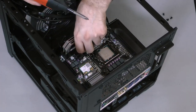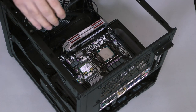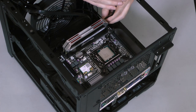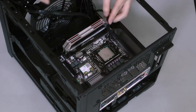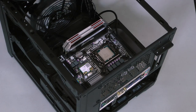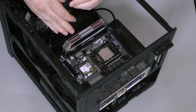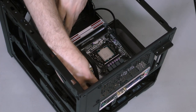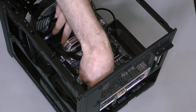After that, I'll need to connect the case headers — check your motherboard's manual to see where each one is. First, connect the audio header that hooks up to the microphone and headphone jacks in the front of the case; this is usually near the expansion slot. Next, connect the USB 3.0 header. Note that the standard for this particular type of connector is fairly poorly designed — the socket on our motherboard wasn't especially tight, so whenever the cables were jostled too much, the header had a tendency to pop out. Keep an eye on it as you're building and re-secure it as needed.